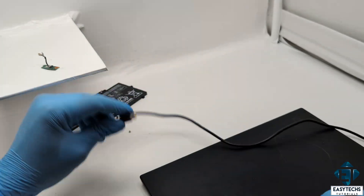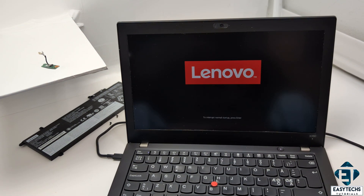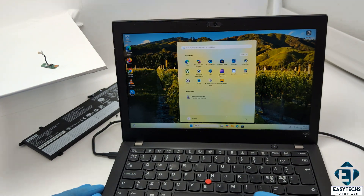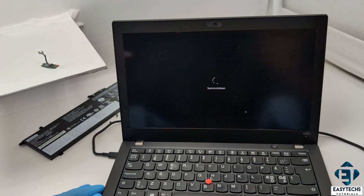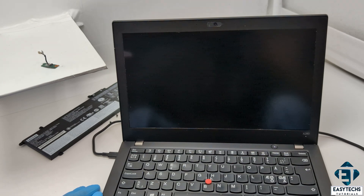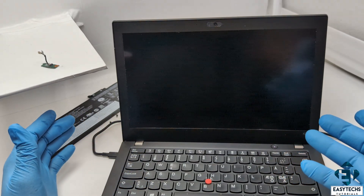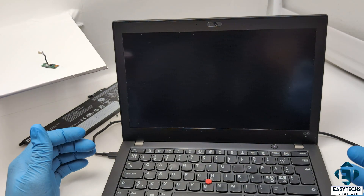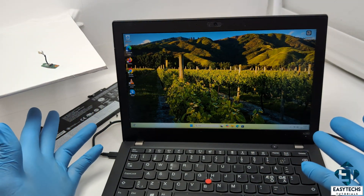Now I will try to power it up to see if that makes any difference. Here it comes on. And now I will shut it down again and try to power it up to see if the initial problem has gone away. And here you have it — this was actually an issue of a defective power button, or maybe the cable connecting the power button to the motherboard. In any case, a change of the power button solved it. I must say that this is a very rare situation. However, if you experience the same kind of malfunction as we saw in this laptop, then you should check your power button.